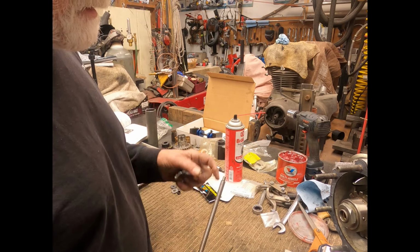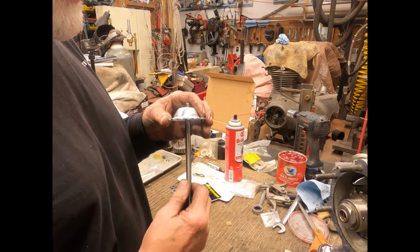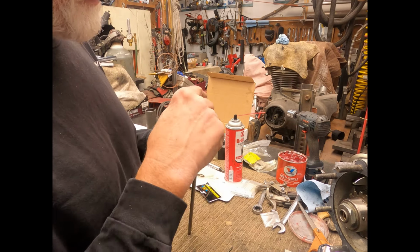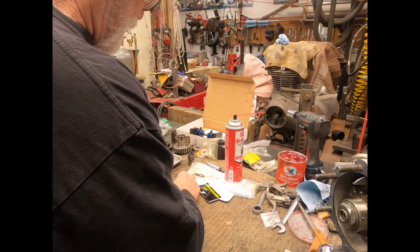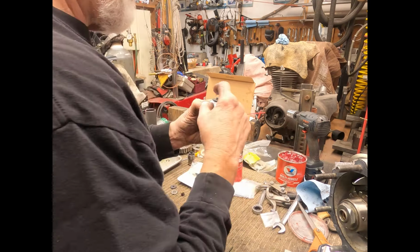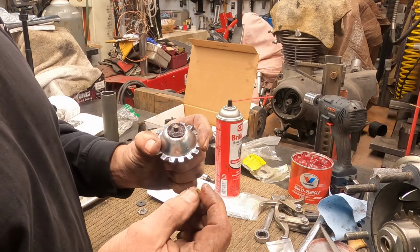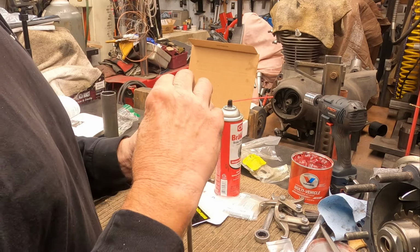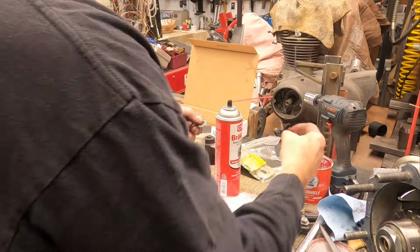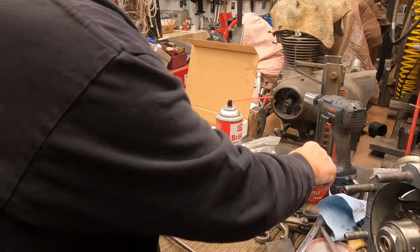All right, one of the other things I like to do when I have these apart is I like to replace the throw-out bearing for the push rod, and this one came with a heavier duty oil slinger, which I kind of like, because what happens, the center of these sometimes get chewed up and eaten out. So this is actually fairly simple. It comes with some surface bearing areas. You put those on and then be sure and put a little bit of lubricant on that. And then it also comes with a center brass piece to align the throw-out bearing itself. And that's just a little needle bearing setup. And it doesn't hurt to apply a little bit of grease on both sides.